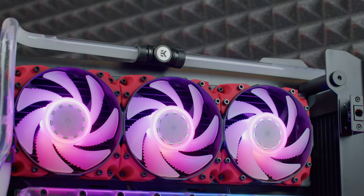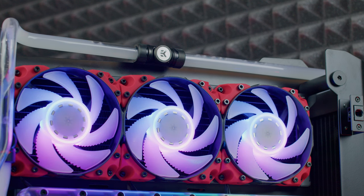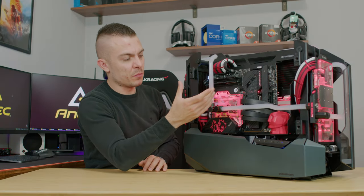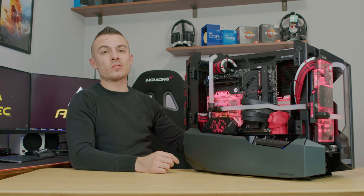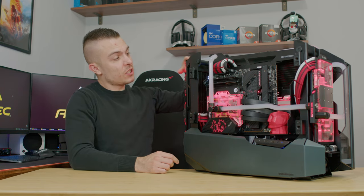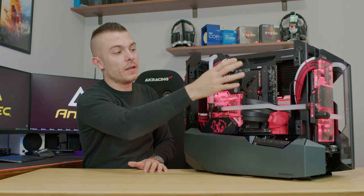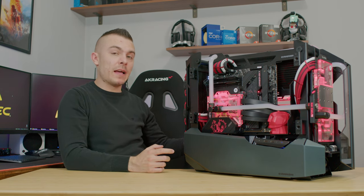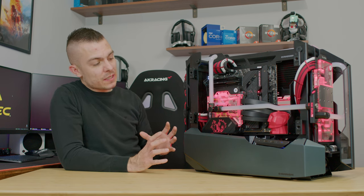Comparing my Striker build and this one, I'm more satisfied with this build. Tubes can go parallel, you can do nice rerouting — it's almost exactly on the line with just a slight bend to connect your monoblock. From the monoblock directly to your graphics card, the card goes back to the radiator, radiator to the distro, distro to another radiator, and then back to your monoblock or CPU block. You can also mount a tube pump reservoir here, leaving more space at the back for another radiator.